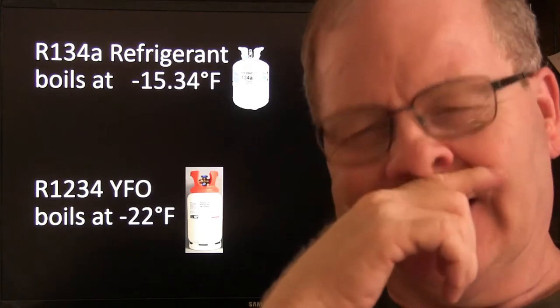The annoying thing about R1234 is how expensive it is. And anybody that's ever done any air conditioner repairs knows just how hard some of these leaks can be to find. A friend of mine contacted me about a week and a half ago, and he said his son had a vehicle that would lose its refrigerant once a month. He lives way off up north here. And I said, well, somebody needs to put some dye in there, because you'll usually find it if you put some good dye in there and get a black light. And he said, well, two shops have done that, and they can't find the leak. We have looked for leaks that we didn't find under the hood when we were using dye, and then whenever we turned on the air conditioner and let it start dripping, you'd see dye coming out the evaporator drain. I don't know what the deal is with the one he was talking about.